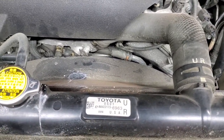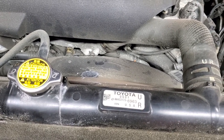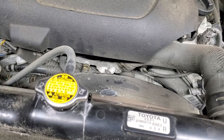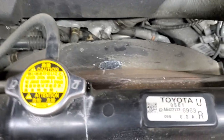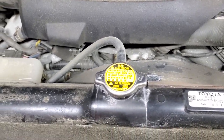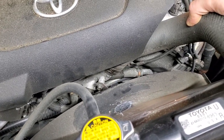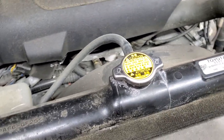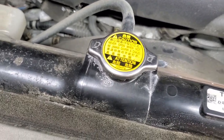Having trapped air is the worst thing — I know a guy whose coolant wasn't bled properly. He was on the highway in winter: engine overheating but zero heat inside. We had to pull over and bleed the air out. He eventually sold the car because once you overheat an engine, the head gasket will eventually fail. Once you fill the system, squeeze the upper and lower hoses to get bubbles out, then close the cap.